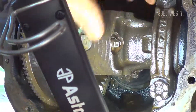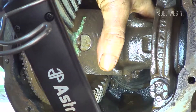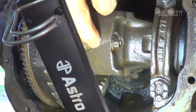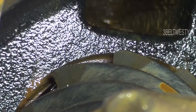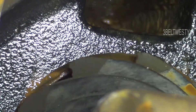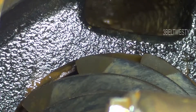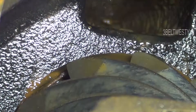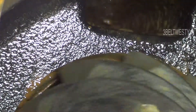Let's go ahead and bomb this with a bunch of stuff and just wait — see if I can let some time work in my side to get this off. Might have to heat this up. I'm zoomed way into the taper roller bearing behind the pinion. You can see it's going at a slower rate than the pinion, which is good — usually they run about half speed with the race. The cage — I think it's just got some crap in it, and that's what the noise is from.